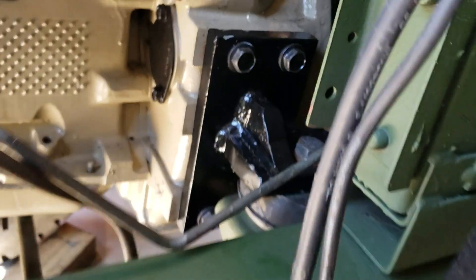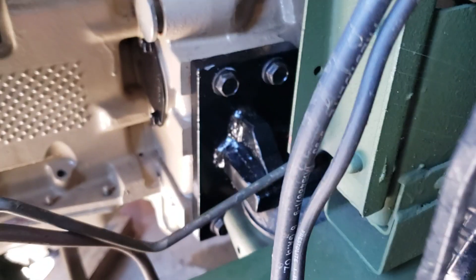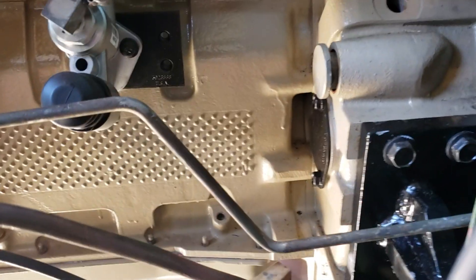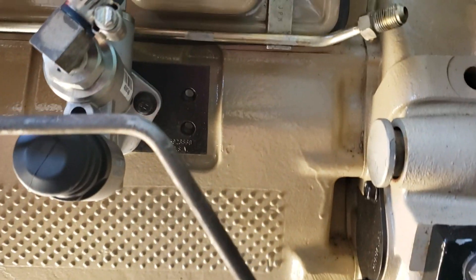But I'm going to show you the principle here. Our throttle linkage connects to a bell crank down here — it comes off the bottom of the pedal. What you need to do when you're making your bends and marks is just shim the pedal up to its full maximum height, so that's where it's going to be with the throttle depressed. Then you put your linkage on. I actually unbolted it there and just have it sitting on there because you need to be able to take it in and out a few times. I kind of eyeballed it, made a mark right there, and bent it there, taking it out a couple of times to get the angle right.